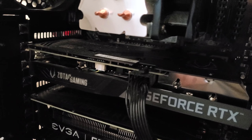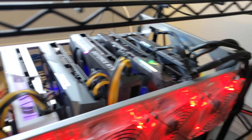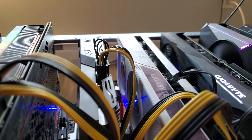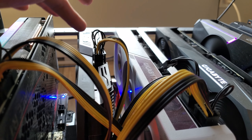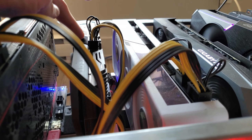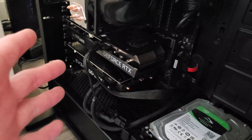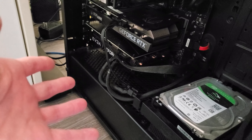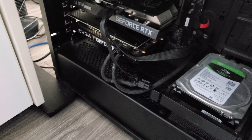While we're here, let's talk about these Zotac cards — the Twin Edge OC ones. This one and the other one in the rig also make squeaking sounds. I know what it's from — it's basically this piece here, which is not secured whatsoever to the rest of the card. At a certain fan frequency, basically most high fan speeds above 70%, this thing gets a frequency going and rattles and makes a squeaking sound. The 3060 in here is worse, but obviously you can't hear it over this thing, which is grenading itself.